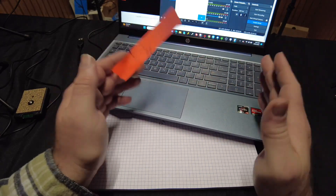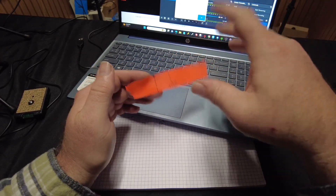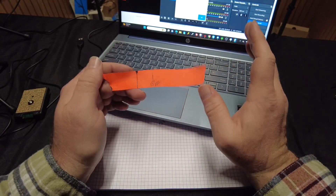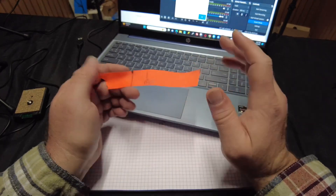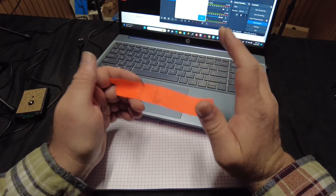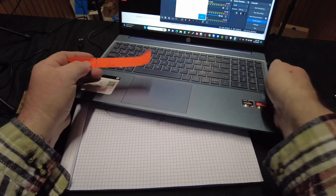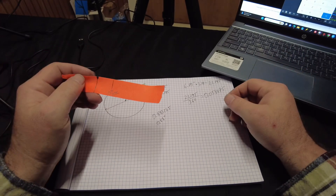It works out pretty good because then you know your engine's at 15 degrees before top dead center. You drop your distributor in, line it up with number one real nice and solid, cinch it down, start it up to adjust your timing — and if you're real good, you might not have to do anything to it, but you're going to start within a degree or so of your actual timing mark. So it'll get you up and running faster and be more accurate. It's accurate enough doing it this way that if you don't have a timing light in a pinch and you're trying to put it together in your uncle's garage, at least you know within the ballpark of runnability. If you can do basic math and you've got a means of measuring and a bit of painter's tape, you'll be pretty daggone close.